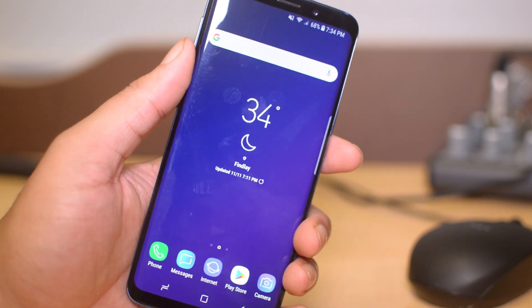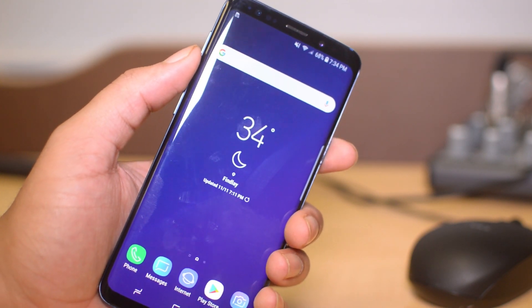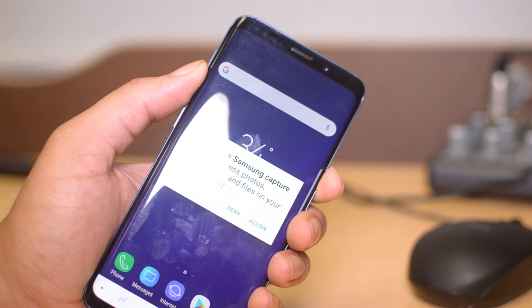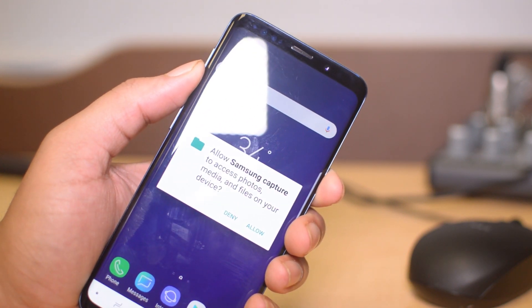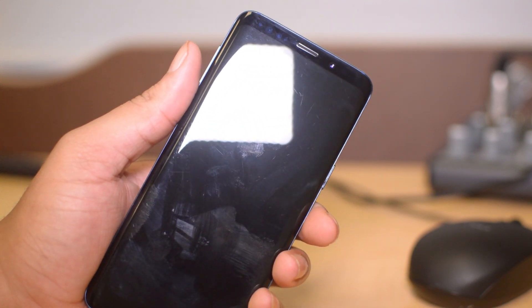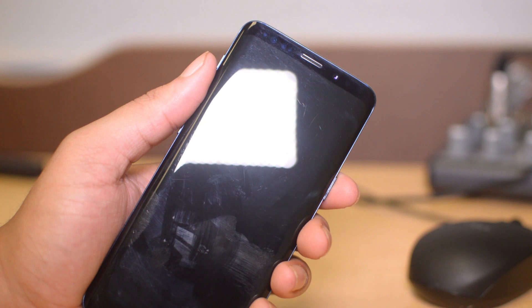To begin the process it's actually very simple. All you want to do is hold the power and volume down button for seven to ten seconds. At first it will take a screenshot if your phone's not frozen, and then after a little while the phone will start to reboot. Once it goes black you're good to go ahead and let go of the buttons.